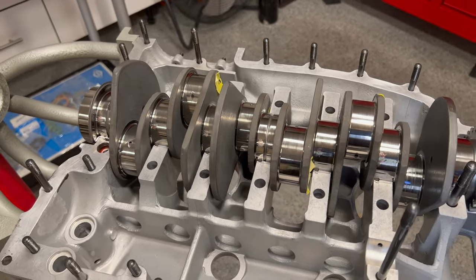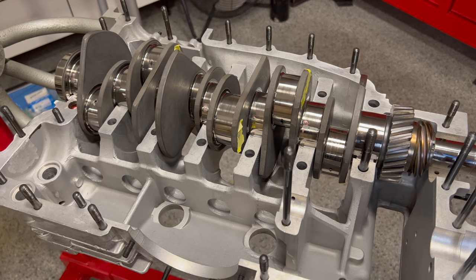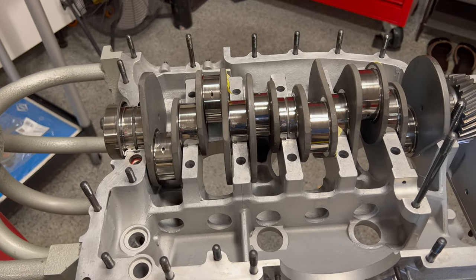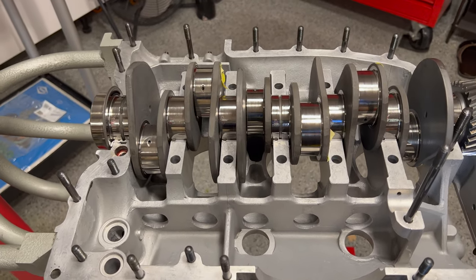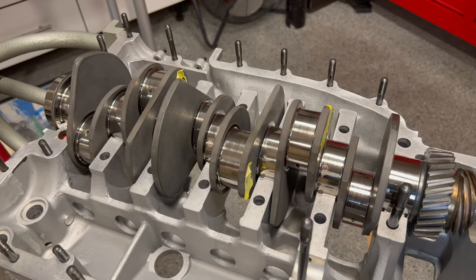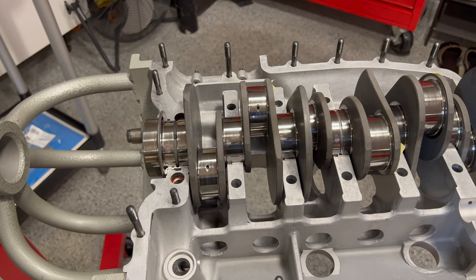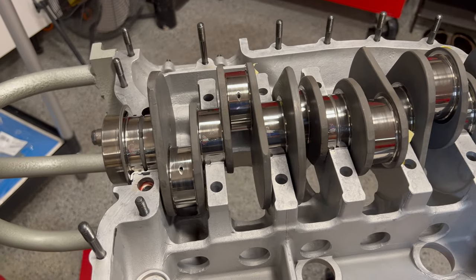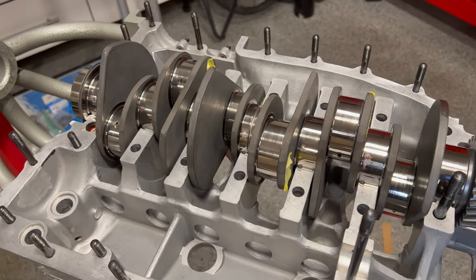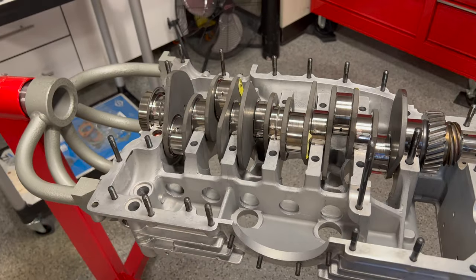So there it is in a nutshell — we basically have the measurements we were after. We can be confident now when we put this thing together that we're going to have proper oil lubrication in all our bearings, connecting rods and main bearings. I can see why this really isn't a preferred method from professional engine builders — it's a whole lot of work and a mediocre reading at best, but it does give you confidence that you're in the ballpark. If you've got really good calibrated measuring tools and you're confident how to use them, you could bypass this and be just fine. But for a novice, a dry run to put it together and verify probably wouldn't be a bad idea. Thanks for watching and we'll see you on the next video.